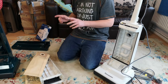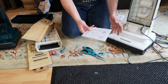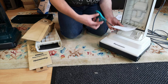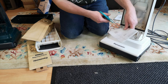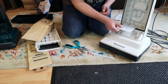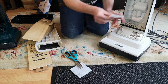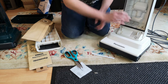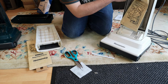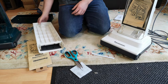There we go - nice and white shining through the back door, for at least 10 minutes. We need to put some filters in and I don't have any genuine Panasonic filters, so we're going to have to get arts and crafts. You should always have some random Miele filters lying around - even the cheap pattern ones are perfect for jobs like this. We just need to cut it a little bit oversized. We'll put it upside down so it's white, and there is a perfectly acceptable pre-motor filter. All it really did was stop fluff going into the motor when the bag burst anyway, so it's fine.